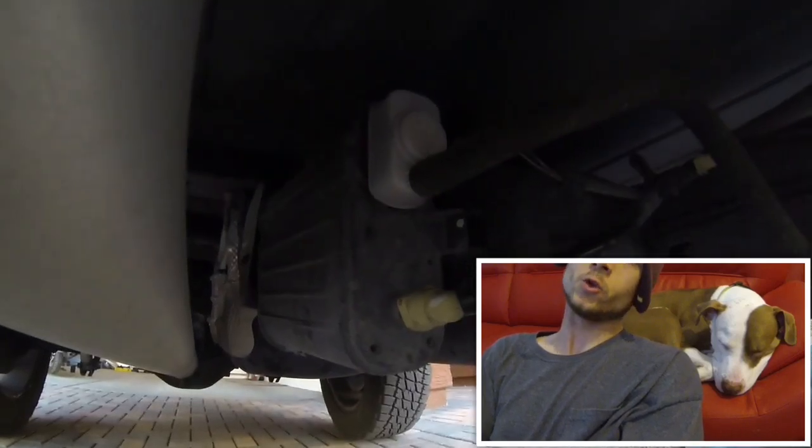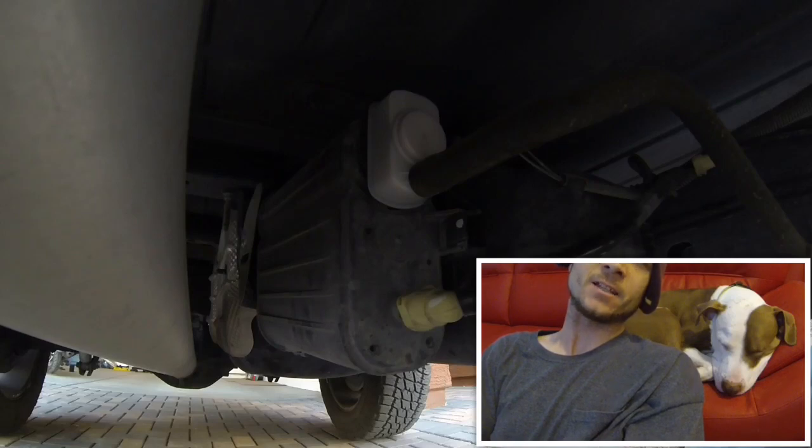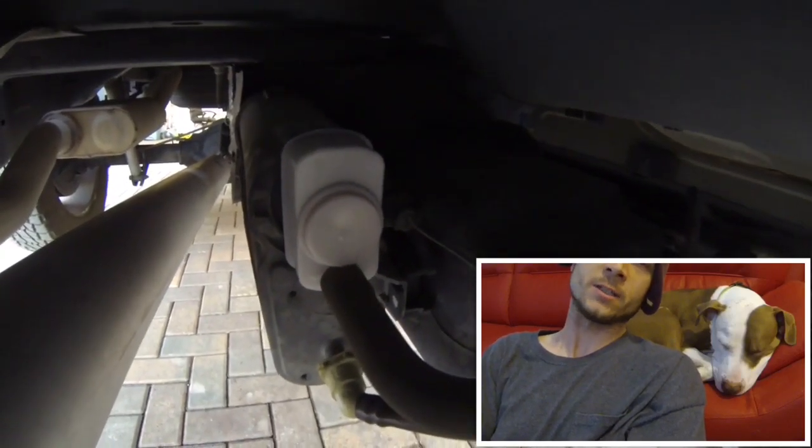Alright, here's a solution I got for you that's rather pretty cheap — about 30 bucks. I've seen them; get the OEM. Alright, leak detection pump. The leak detection pump went out on this, which was throwing a false code saying it had a small leak, which it didn't. It was just the leak detection pump was bad.